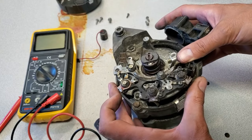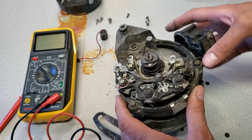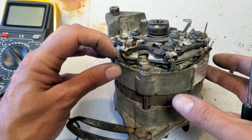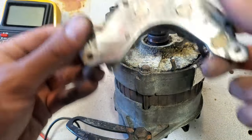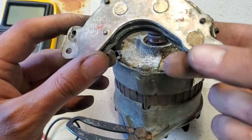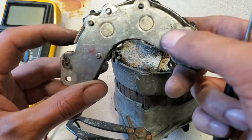To get the rectifier circuit out I need to unsolder the three wires connected to it before I can remove it and separate the bodies. I've fired up the soldering iron and taken care of that. I've now got all the windings unsoldered from the rectifier pack so I can simply remove it. These bolts were pretty difficult to get out because of the corrosion — you can see all the galvanic corrosion going on. The Lucas 3RU — it looks like it was dated 1984, week 33. Fairly new alternator.